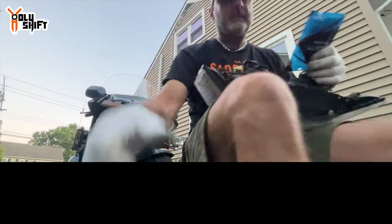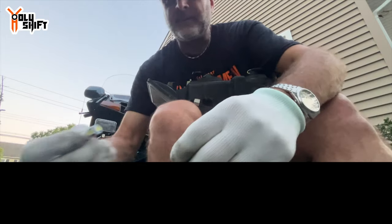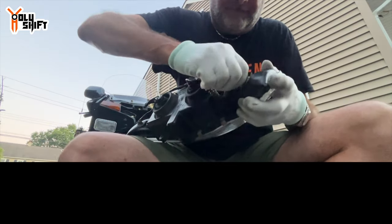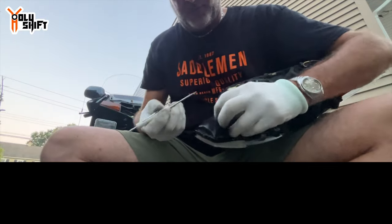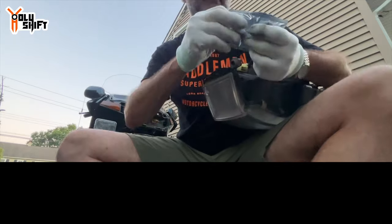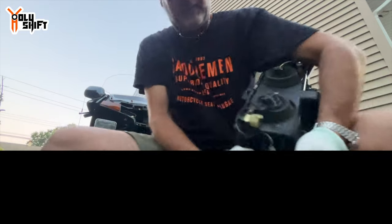Here's what the bulb looks like installed. There are also small secondary bulbs on top — look how cute they are. Same bottom, same receptacle — clicks right in. Pop it in, rubber seals the whole thing. Do the other side the same way — a sharp screwdriver pops the grommet out, the old one comes out, new one pops in. That's it — everything is in.